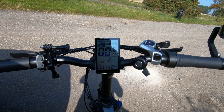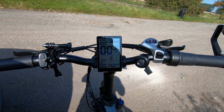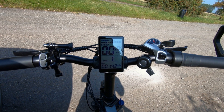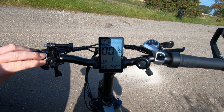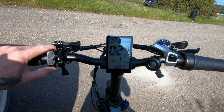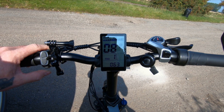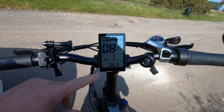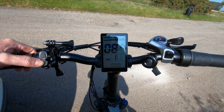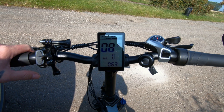Hello. Today we're going to be testing what changing the setting in the 08 actually does to the speed of the bike. First, press both buttons to bring up the settings, then press the mode button to go to 08. You'll see it's set at 63 — that's as high as it goes. If you go any higher it goes to zero. 63 is the highest; that's as fast as the bike will go.